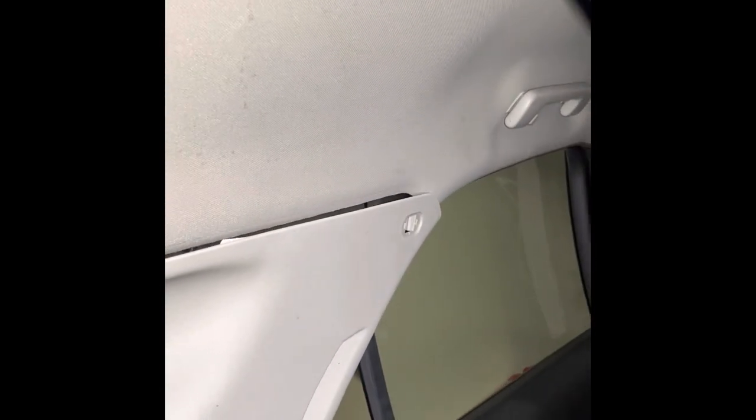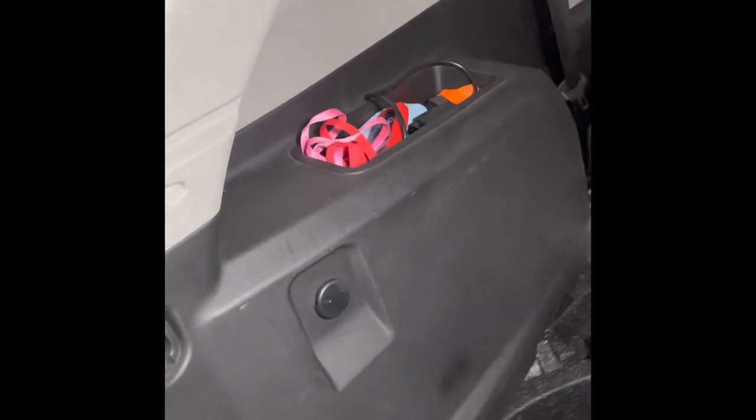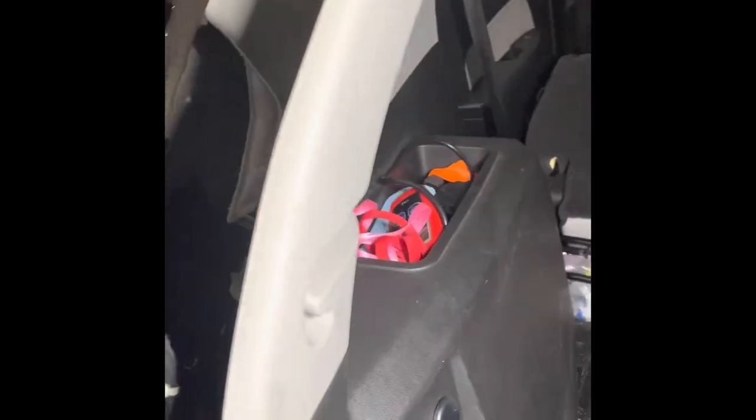There's also another SRS bolt up in the corner where the seatbelt is. You want to remove that as well — it's the same as this one. Remove the plug and there's a screw behind it. The wire is going to be traced down along the backside and it's going to plug into this module right here up on top.